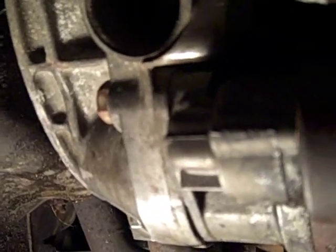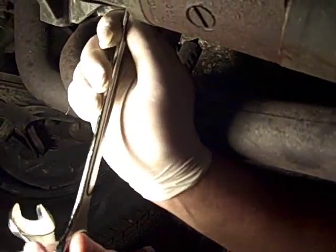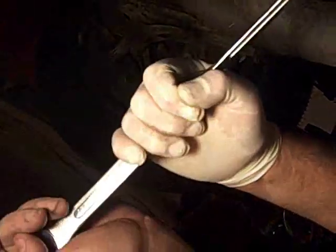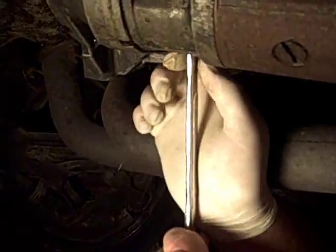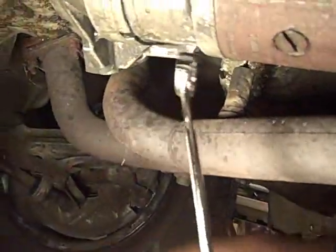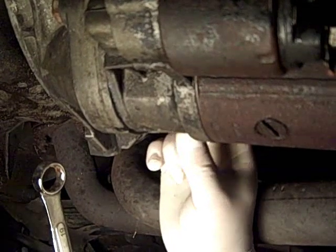What we did is we used two wrenches. I took a 19mm box wrench and put it on. I had to use the bent end forward so I could get the leverage. And then using my 17mm, I actually created a breaker bar like this and pulled with the extra leverage, and I got the 19mm bolt loose enough to go ahead and pop out. And we did the same thing on the front bolt. So let's get it out almost all the way.